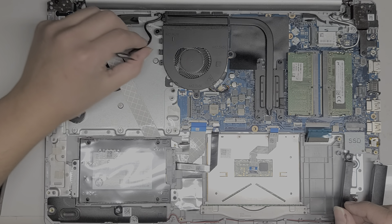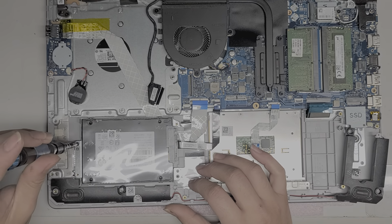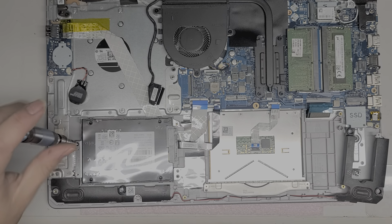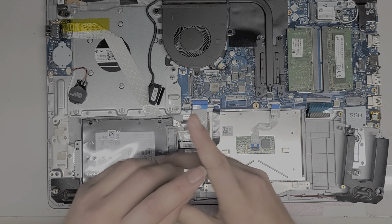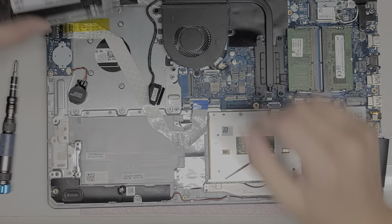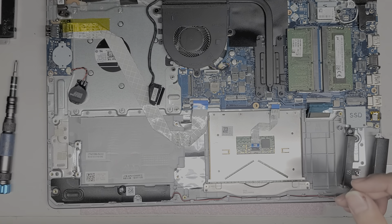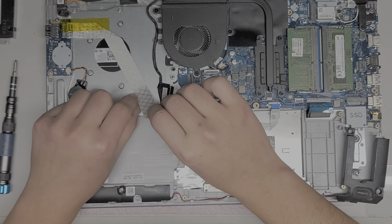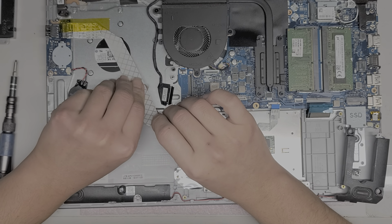Then guide this wire out of the way. We're going to remove everything, so let's remove the hard drive first. I only see one screw here and one screw here — there should normally be four, so it's kind of strange. Once you remove the screws, you should be able to lift this up, and then set that aside. This cable has an adhesive, so you want to peel it up, keeping the cable as flat as possible.